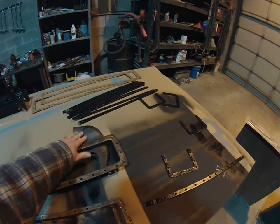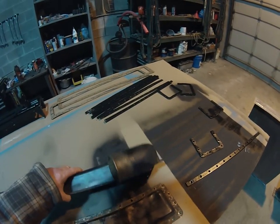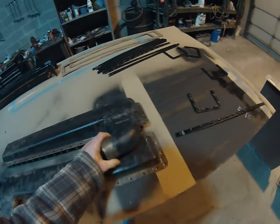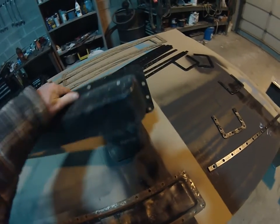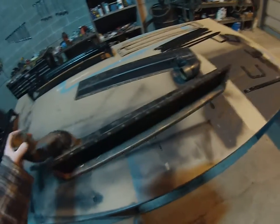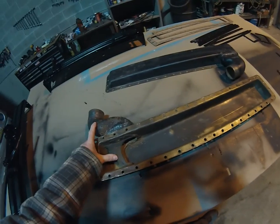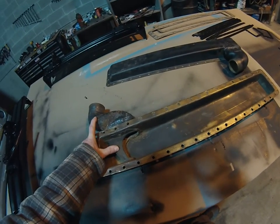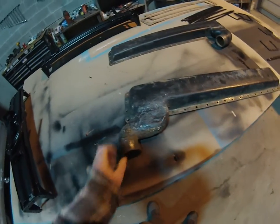On the top, this outlet is actually a cast copper or brass fitting, as you can see by the color on it. It's brazed in place. There's a spot weld piece here. You can see right there. So that was all good, but I knew I had seen some pitting on this. Well, the bottom tank, which is also copper, is a little bit more beat up, and for some reason uses a cast iron outlet. So this piece here, which is all factory, is cast iron. There is some corrosion on the outside, some pitting. The inside is pretty clean.